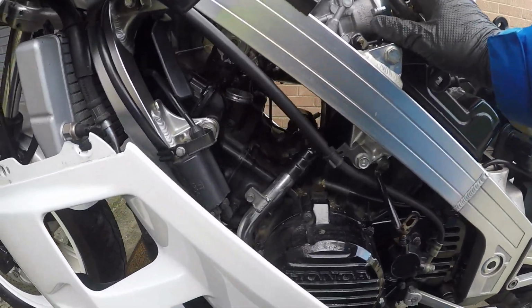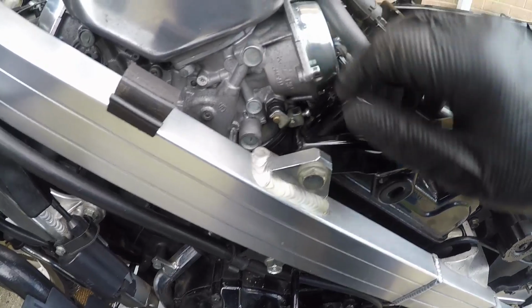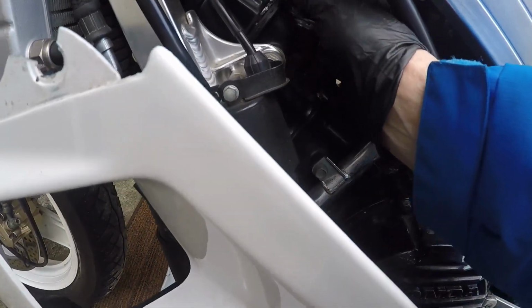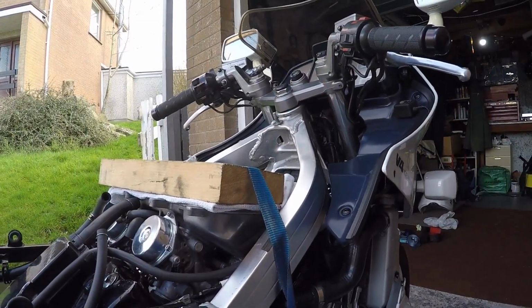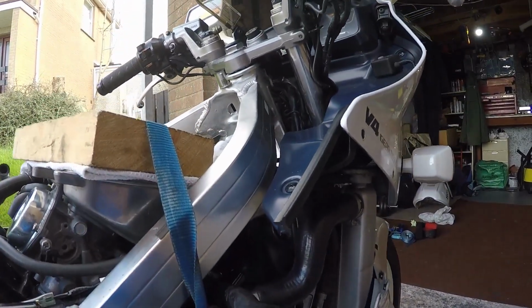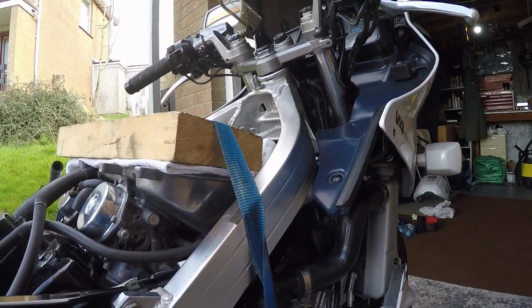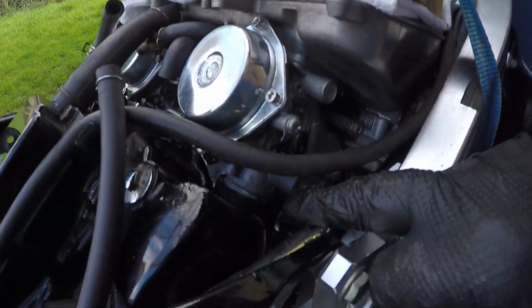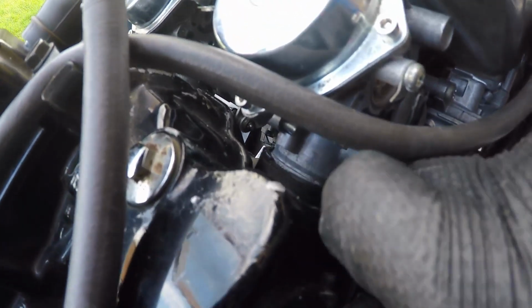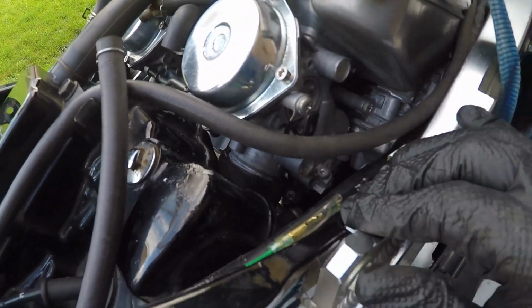The issue is when you get the back carburetors close to the carb rubbers, you can see you're about 2 nautical miles away. Right, you're not going to believe this, but this is the way it is. The 2 front carburetors are into the rubbers. The rubbers are on the head, and I've got all the hose clips locked up. The back 2 carbs are just on the edge of the rubbers. The clips are in place, but obviously they're not tight because I have to allow a bit of room to slip in. Both sides are the same.